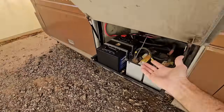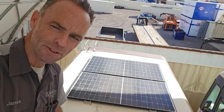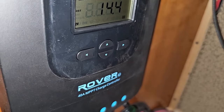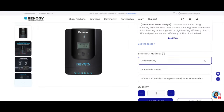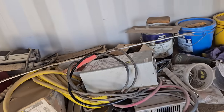If you're upgrading to lithium batteries for energy storage, you're probably also putting solar on the roof. I would recommend taking the money you would have spent on a new charger or inverter and investing in solar — a little bigger than you thought you'd need. With at least 500 watts of solar and a fairly inexpensive MPPT charge controller like the one I have from Renogy, it will have a profile for charging lithium batteries. You get that last 10% of charge from the solar for a fraction of the cost of a new inverter or lithium-compatible converter.